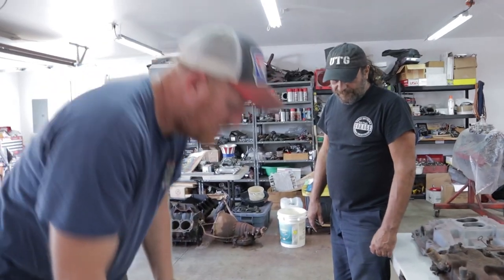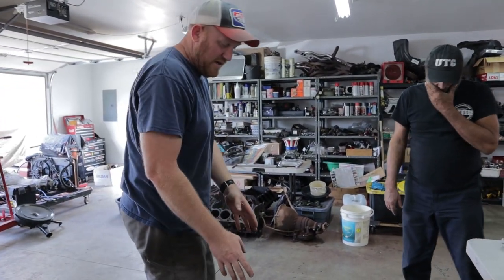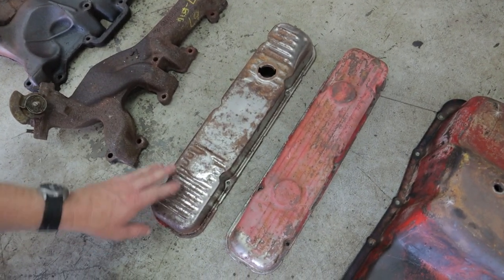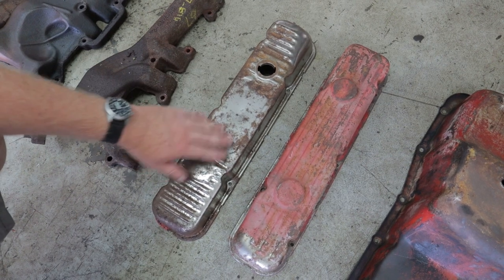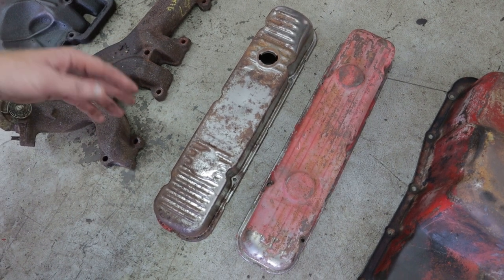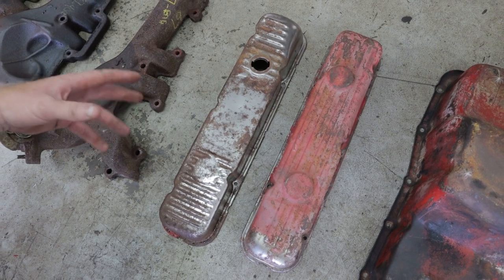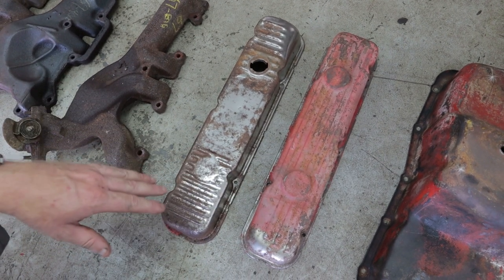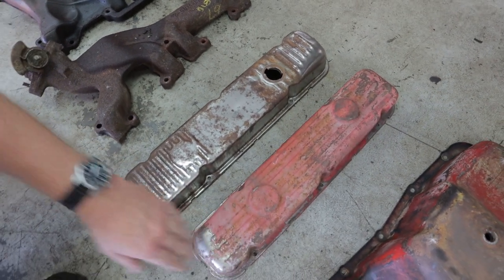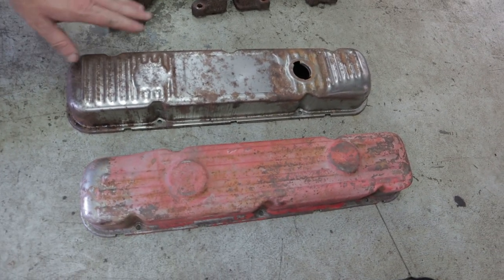That 400 I got just had a dented pan and it was okay. Valve covers: '67 to '69 this is how they looked. If it was a Stage 1 motor or any performance application, you'd have a decal here saying Stage 1. In '67 to '69, Stage 1 was different than '70 and later — it was literally just a camshaft, carburetor, and distributor recurve. In 1970 is when it actually got its own heads. This is the '70 and later valve cover — as you can see, the lines run lengthwise, more or less vertical.